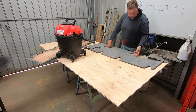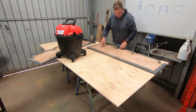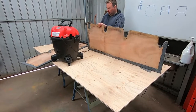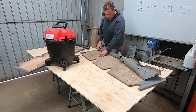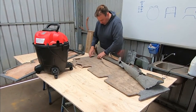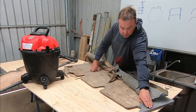The second thought to that is it's super thin. Look at that. So we won't be using the carpet, but we'll be using the board. So that's okay. We'll strip this off. Well, the top layer of this board's got a little bit of delaminating happening, so we'll still be able to save it. Yeah, that's come off. Get that out. So that top sheet's out, that next bit's okay, so we'll just take that bit off, recarpet it, or clean it up, probably seal that with paint, and new carpet over the top, I think.